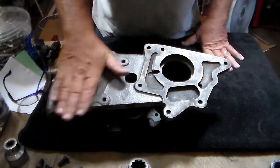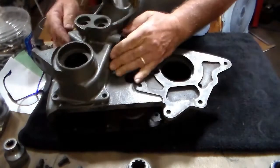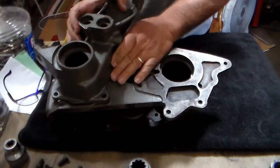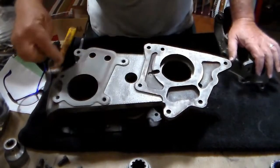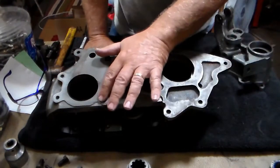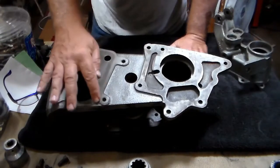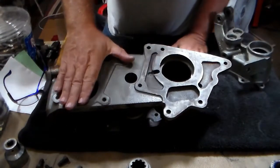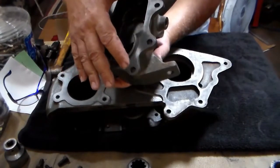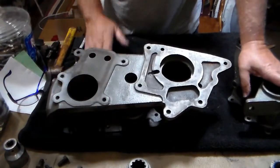This side over here is where your front bearing retainer assembly is going to go. We'll get into the bearing retainer assembly later, but this is where it's going to ride. You've got five bolts — make sure the threads for all five bolts are good. Make sure that none are standing proud, like this one here is standing just a little bit proud. So what we're going to do is take a file and file that down just a little bit, because if you don't, when you try to bolt this down flush, it can catch on the surface of the bearing retainer and keep it from going all the way down flat, preventing a good positive seal on your gasket.